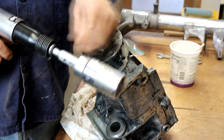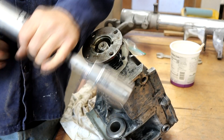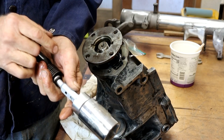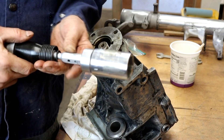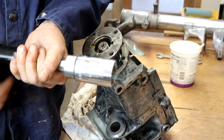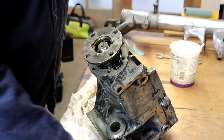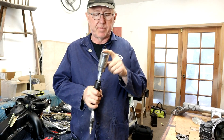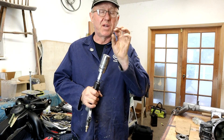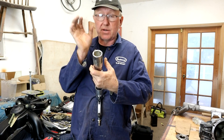This is great because we can change out different sockets for different applications. You'd probably want to turn the drill down a bit so it's not so aggressive — there is a valve here. You can change these out for different size bearings, and I'm also thinking this would be a good seal press too — to get a nice controlled hit with different size sockets. The spray paint is optional, makes it look more like a proper tool. Obviously pick your socket size to correspond with the bearing or seal you're driving — make sure you don't damage it, not hitting on the soft part of the seal, and not so large that it damages the sidewalls when driving a seal into an axle.